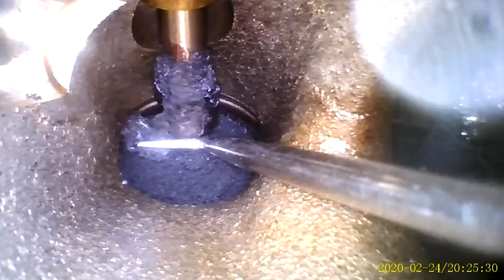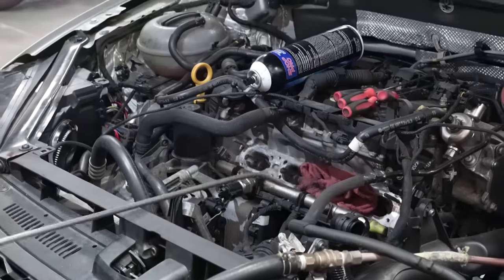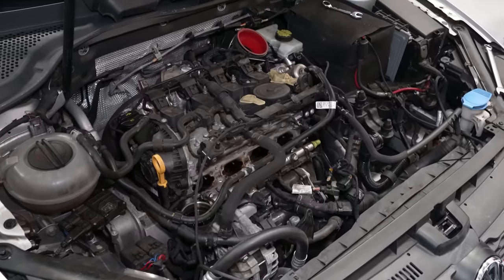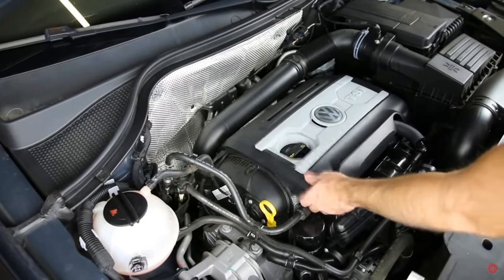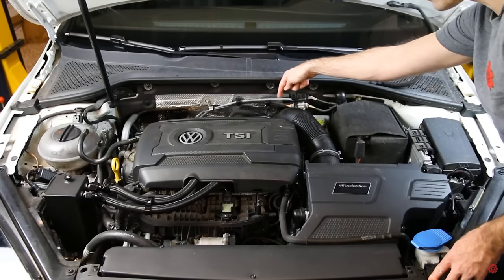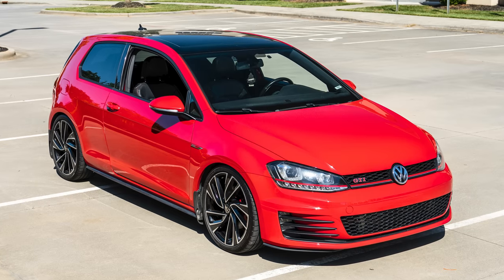This issue is commonly found across a wide spectrum of manufacturers like BMW, Mercedes, Hyundai, Volkswagen, Audi, and even Honda. In the Volkswagen Audi world, this has been a common problem for some time, but some newer engines do not have this problem. If you have a Volkswagen or Audi with a 2.0T FSI or 2.0T TSI engine from around 2006 to 2014, these engines will have that issue and it needs to be addressed every 60,000 to 70,000 miles. If you have a 1.8T or 2.0T Gen 3 engine from around 2015 and later, carbon buildup is very uncommon on those cars.